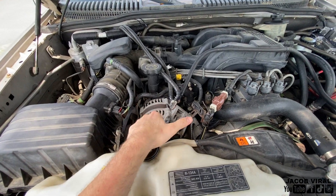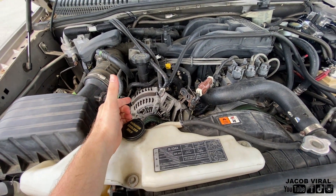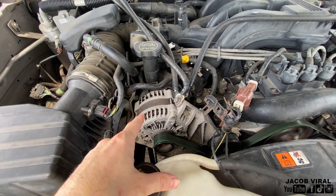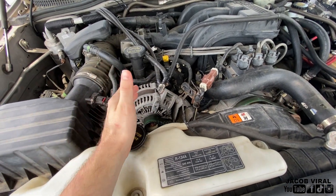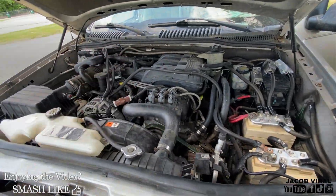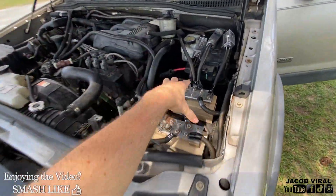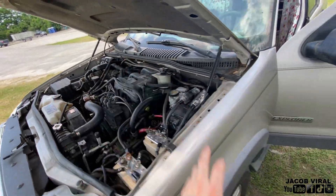I have a 350 amp alternator. Right now it's only seeing about 100 amps to that lithium at idle, so the voltage is going to drop a little bit. I'll show you how the voltage drops too — I have a meter back there. At idle it's only 150 to 160 amps, and it's a little hot, so probably after vehicle compensation I only get 100 amps to the lithium back there. And I just deleted my battery bank — I had an AGM there — so I'm all lithium now.